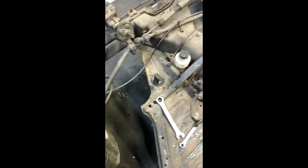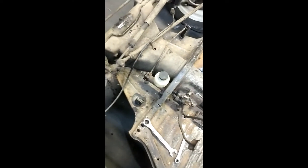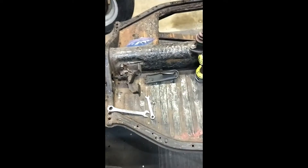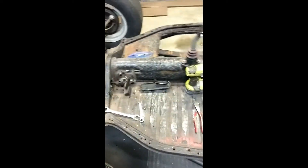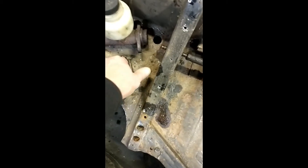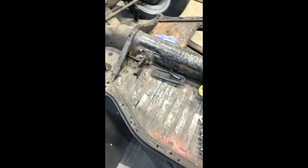Start pulling the rest of this last little piece of brake line off, then break the master cylinder loose and take it out completely. There it is — last brake line pulled. Got two bolts in the master cylinder after pulling it out of here — old and rusty, ready to go bye-bye.